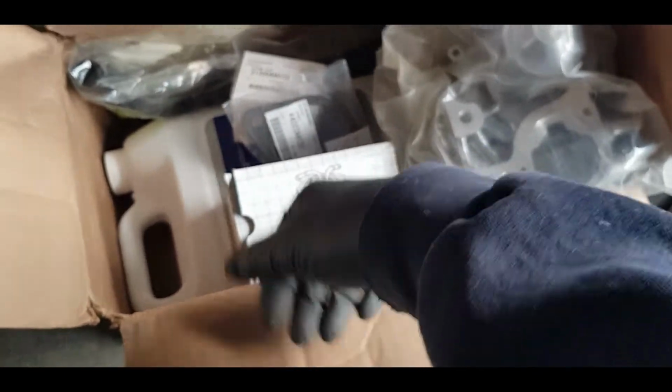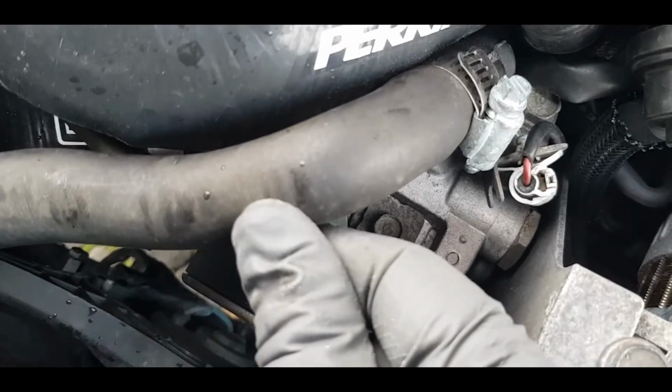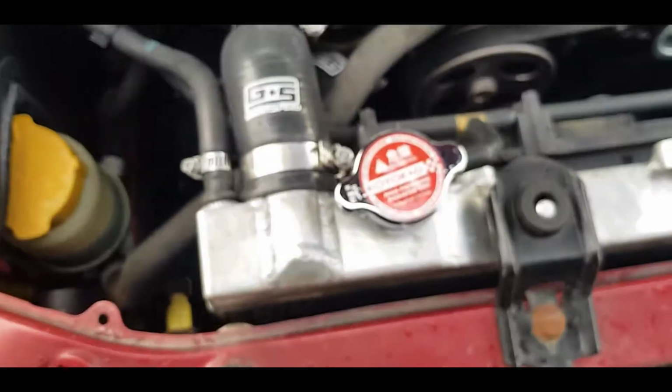But anyway, bought an antifreeze. This is a power steering hose return. If you look at this one on here, it's a little dry rotted in my opinion. You can kind of see some cracks in the hose, goes down in there. So I figured, well, if I'm gonna do a timing chain while I have it off, I might as well do a fluid flush. The hose was like 20 some bucks, and then the return is over here. I may go ahead and spring for that too, but I need to do some plugs on it, because in my opinion it idles a little rough.